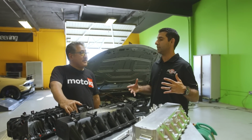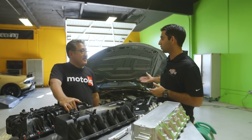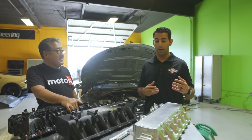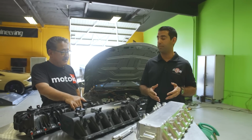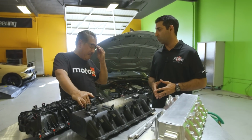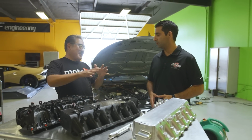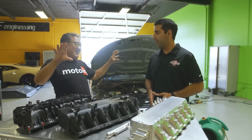So all of that really limits the ability to do drastic changes in terms of putting a bigger air-to-air intercooler. That's usually the easiest, and that used to be so prominent on the old school Supras like the MK4s. Now we really have to spend a lot of time with designing, CFD analysis, the core spec, to be able to make something that actually works better in the car. And CSF is going to come out with that whole cooling module, right, with all the heat exchangers.